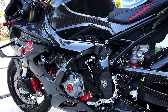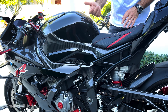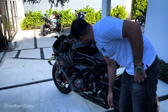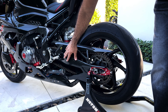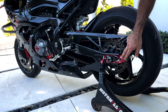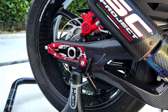One of my favorite mods on an S1000RR is the Alpha Racing Quick Shifter. It makes this the nicest shifter on any superbike, I think. The quick shifter on this bike is beautiful from the factory, but the biggest issue I have with it is the spongy feeling — this gets rid of it, makes the shifting a lot more responsive and direct. We have our Full Six swingarm covers with the shark fin piece on it as well. We're using the TWM chain adjusters — these click when you turn to adjust them. We always recommend adjusting by the precision-machined marks so your adjustment is correct on both sides.